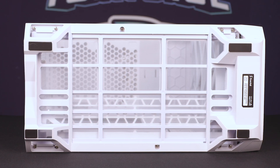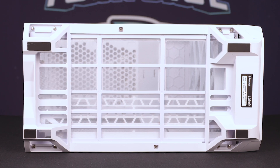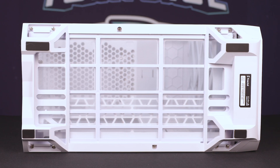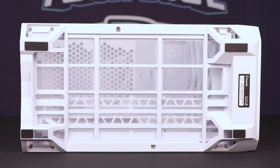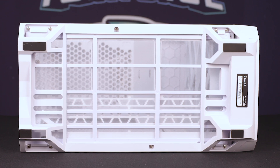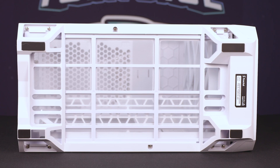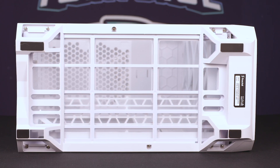The reason I don't really like that is because if you've seen other water cooling videos, it's going to make the pump the high point of the build, where it's better if it's up top — because then the air is going to sit naturally on top of the pump and your motor is going to wear out over time. So I don't think that's the honest intention. I think what they want you to do is fill that space up with fans that can then push up into your cooling.